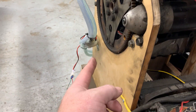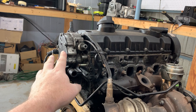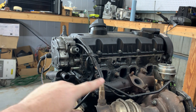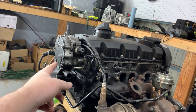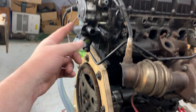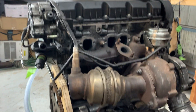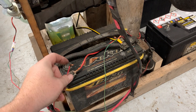I have a very simple little 5 psi lift pump that lifts the diesel out of a small tank and into the tandem pump. This tandem pump performs two functions: one, it creates vacuum for the brake booster — diesels don't do that automatically without a vacuum pump. The other function is it acts as a high pressure fuel pump. So this is the lift pump as the first stage, the tandem pump as the second stage, and the third stage is the unit injectors. I'll connect up the fuel pump here.